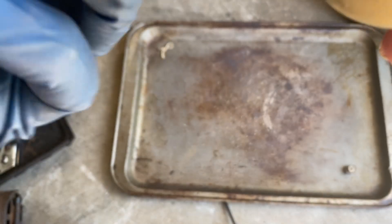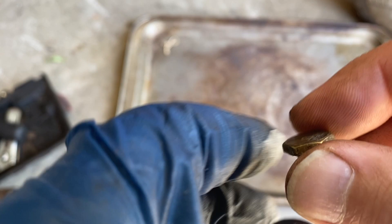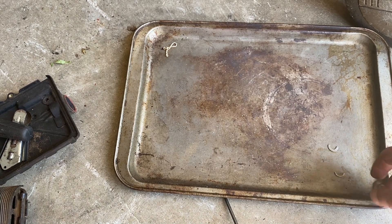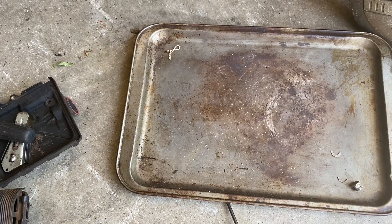It's not half bad, but it's stuck. It needs a rebuild. Let me see if I have another carburetor before I go and rebuild this one, because it's all corroded - see all that white? It's probably all ethanol damage. The bowl nut jet is all clogged and the gasket just broke in my hands. I'm going to look through my box of carbs and see what I find - I think I can take parts from three different carburetors and get one to work.